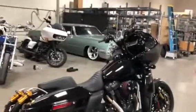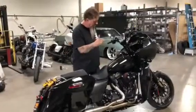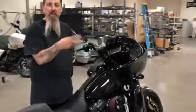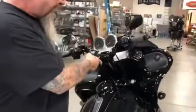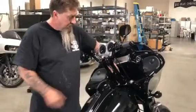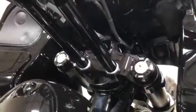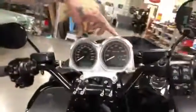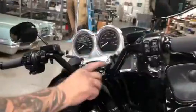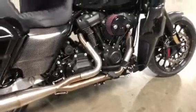So what we did on this bike: we did our inverted front end, the FG301 on the front end. We did three-inch extensions in the front, raised the bike up two inches. We did our gauge relocation. We did a keyless start for the ignition, so there's nothing on the triple trees — it's all clean. We just ran the wire straight into the frame. It's got our new gauge buckets, but we're waiting for the black one to come in from the anodizer. We did three-and-a-half-inch rise bars, our risers, our mid-control kit, our pipe, and an S&S air cleaner.